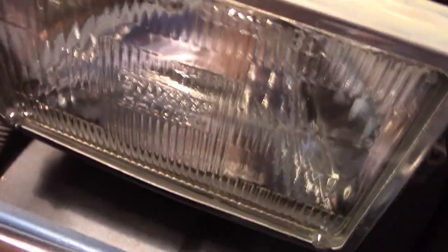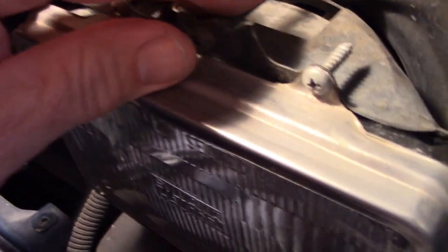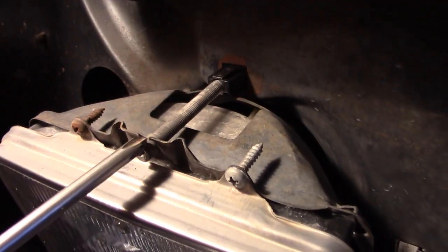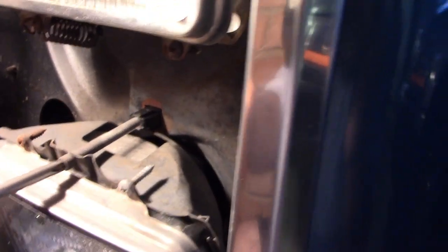I knew I had changed this one out one time before. So it's getting the same thing again, which will break again. But notice the old screw just drops in there like it normally should. And then I can start running that screw in and get my headlight pointing back straight out. I'll come back when we get that going.